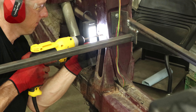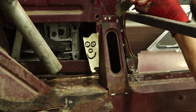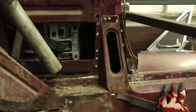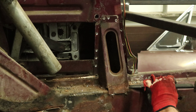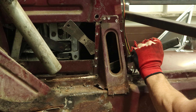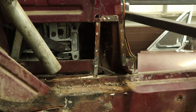So now we can start drilling out the spot welds on our little quarter brace here. Look at Richie Rich over here with this new drill. Now we'll put our breaker in there, break these spot welds loose, knock the seam welds loose at the bottom. It's hard to get to the backside so I just slid underneath the whole thing. I win.